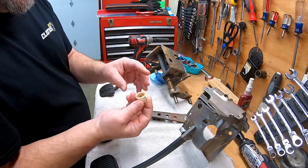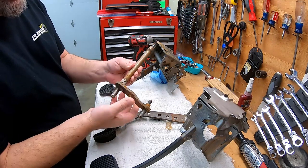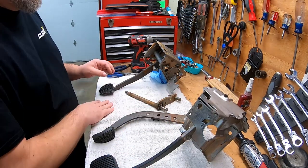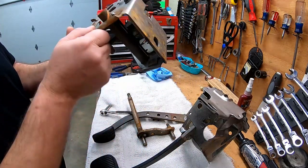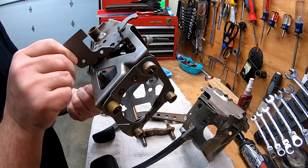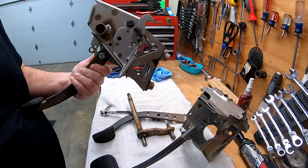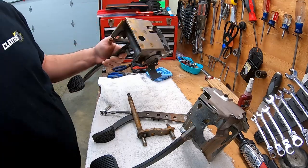This bushing looks like it's in pretty good shape. I bought another one of these clutch pedal assemblies that's missing the bushing so it's pretty clunky. I'm just going to keep those bushings off for a moment to protect them. So I've got to grind this weld off and try not to mess the tube up at the same time. I'm going to use an angle grinder and a cut off disc outside to keep the dust down in the garage.